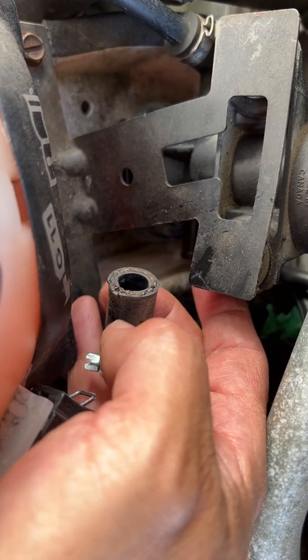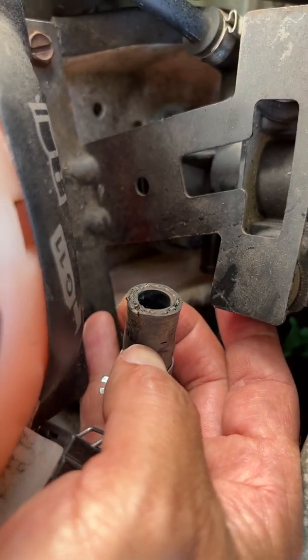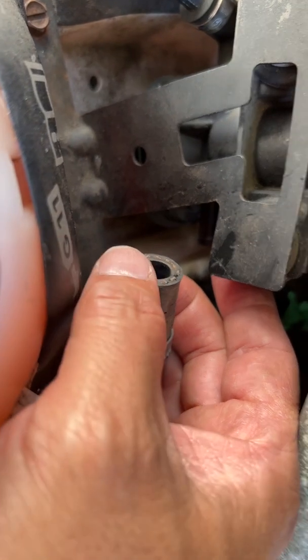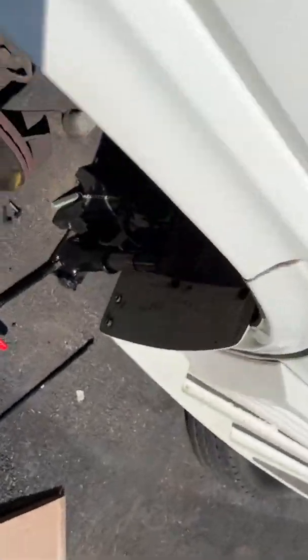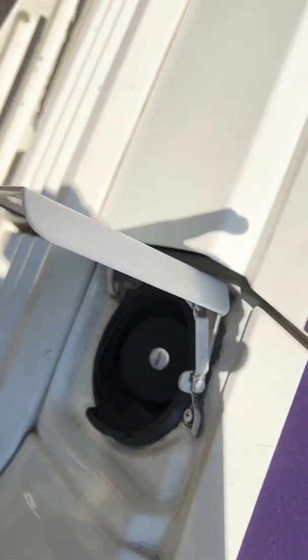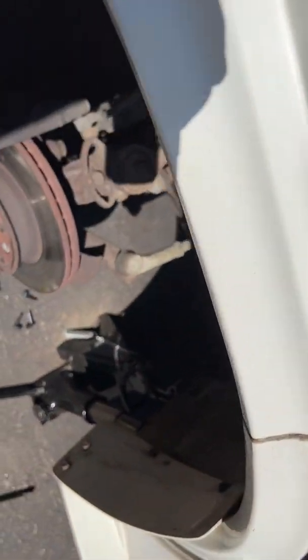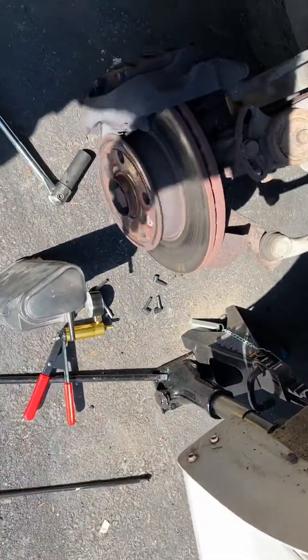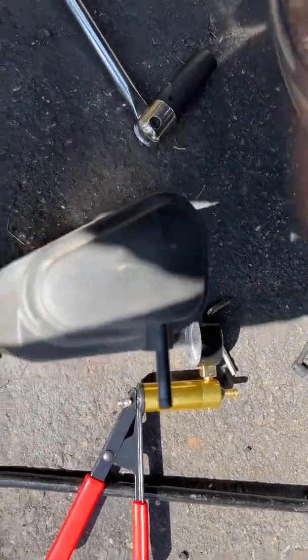Then I put some air pressure into this side here. Initially the pressure was pretty high — over 50 pounds — so maybe there was some kind of blockage in this hose, but I just kept putting pressure in. I plugged up the other hole and then checked whether we got pressure through, and we did, which proves that the lines are clear all the way to the gas tank. I'm thinking there was some blockage in those lines which I've perhaps cleared by pressurizing the line, and there didn't seem to be anything wrong with the evaporative canister.